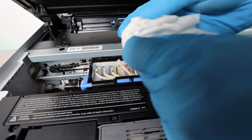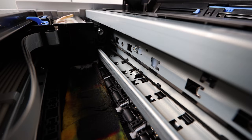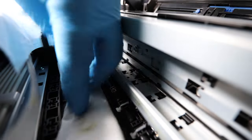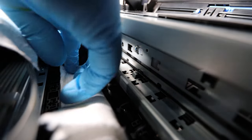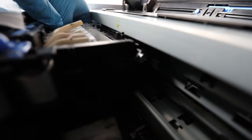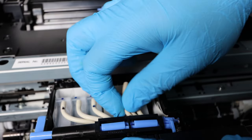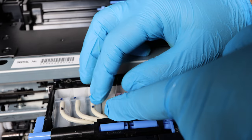Do the whole 20 milliliters — do it once, twice, even three times until you are satisfied. When you're pushing this cleaning fluid through, you really need to pay attention to the paper towel below the printhead because this will get soaked. Every 10 milliliters, take out the old one and place in a brand new folded paper towel. You could even move the printhead to a drier section of the paper towel. That way you avoid getting the area messy. Basically, you're pushing out the blockage and any sludge that is blocking the printhead from printing a certain color, so all that excess fluid has to go somewhere.